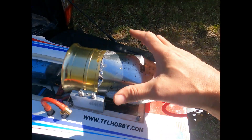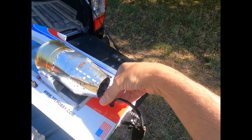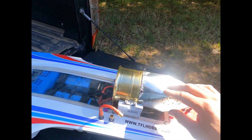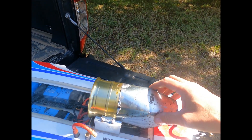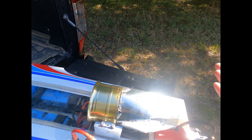I'm going to give this one another go now. I made up this cone just from an old paint tin, so it's more of a nozzle — smaller at the end than here — so that should help with the top end, I hope. Apparently if you leave it open it's better for acceleration, and if you funnel it down it's better for top end.